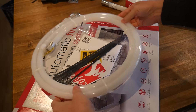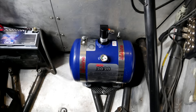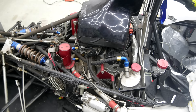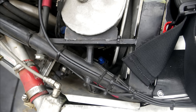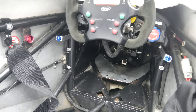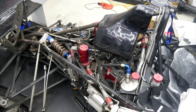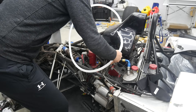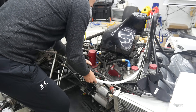Let's start by installing a T2000 2-meter version, which is destined for my race car. Now this car already has a built-in fire suppression system — the rules mandate it. Spread around the engine bay are three nozzles connected to a tank: one pointing back towards the engine and fuel system, and one on either side pointing towards the centre. There are also two more nozzles facing the driver in the cockpit. The system is manually armed and activated with the big red button. That should save me and the car in the event of a fire, but what if I'm knocked unconscious? Because of this, I'm very glad to install a second automated system. This version of the T-Series line and the installation location was recommended after consultation with BlazeCut.